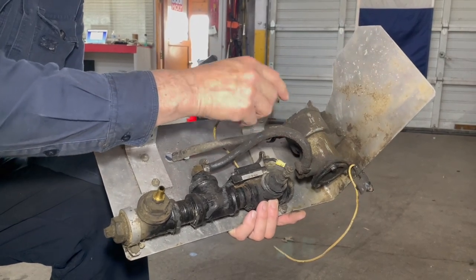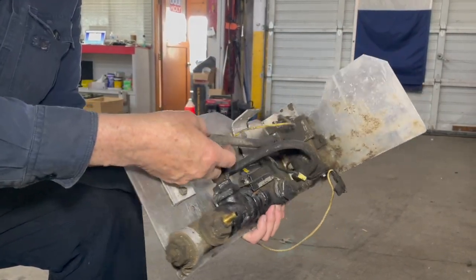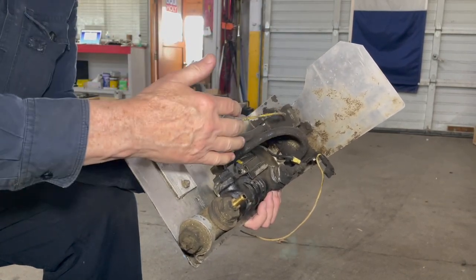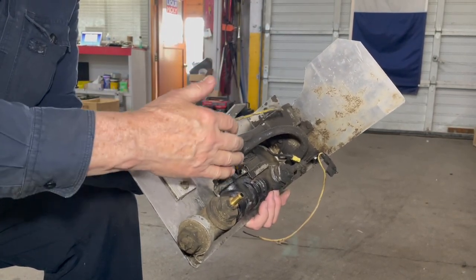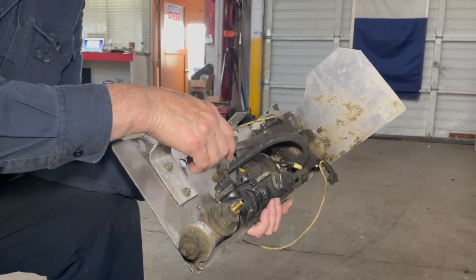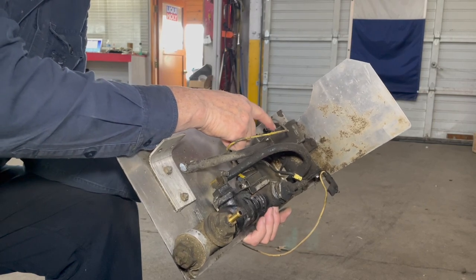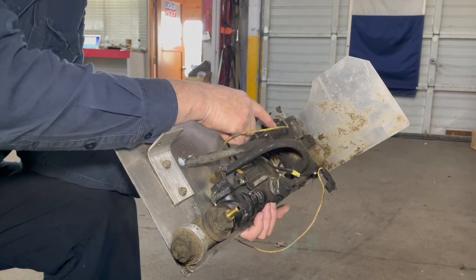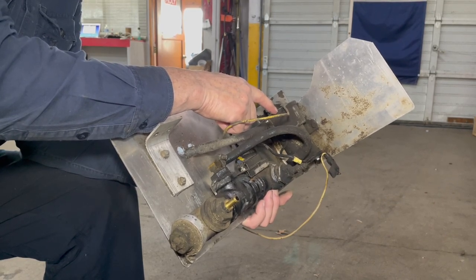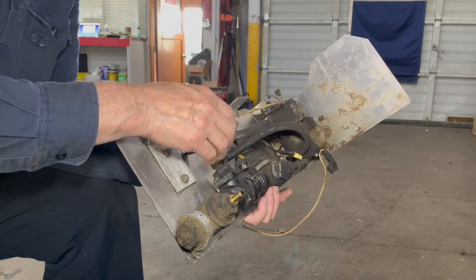This electric fuel pump will then push the fuel up to the engine. I've said this before and I'll say it again: if you're going to run straight vegetable oil in a single tank system on an old Mercedes diesel, one of the best things you can do is add a fuel pump at the back end, because the engine-driven lift pump just doesn't have enough oomph to suck all that thick fuel up to the engine compartment.